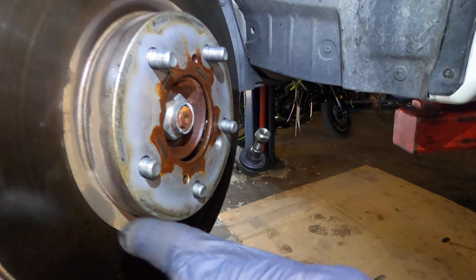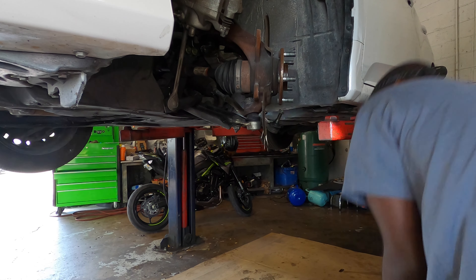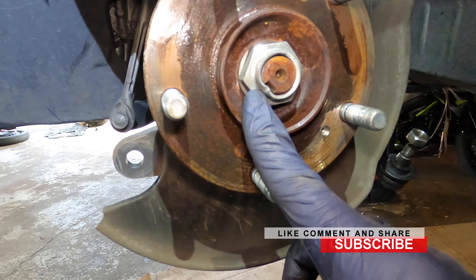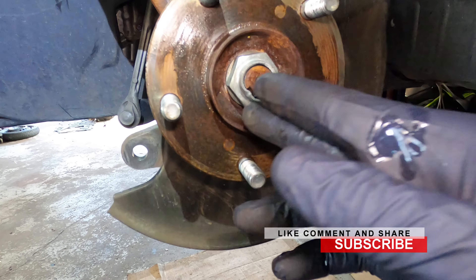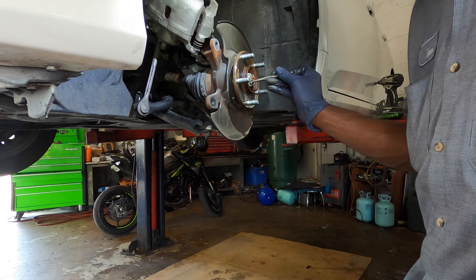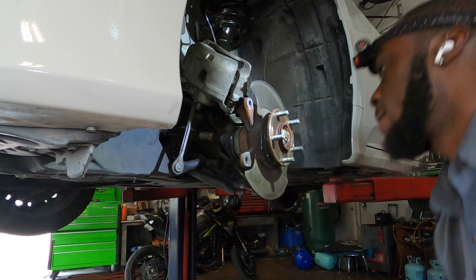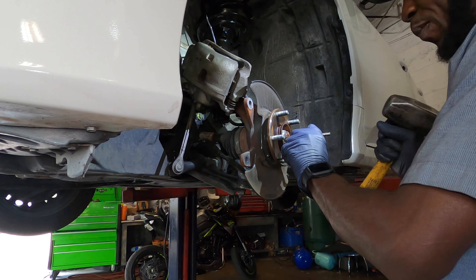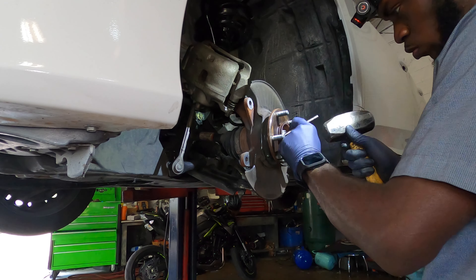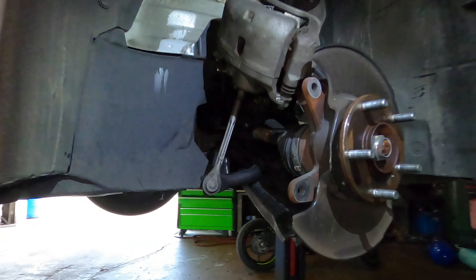You might have to knock around the edge like this to get the rotor off. Now we need to take this off — get a center punch or something like that to take this part out. Knock it anywhere in here, and just like that it comes free.